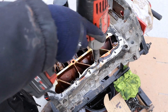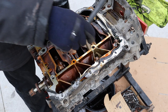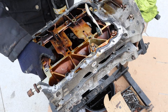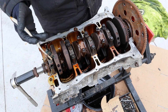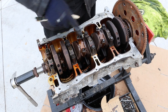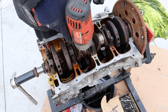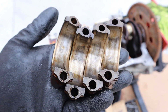Let's get these 12mm bolts out all the way around the perimeter. So here we've got the bottom end of this 2.0L engine — things are looking pretty simple. Because this is a low horsepower engine, we've only got two bolts on the main cap bearings, and there are five total main cap bearings. Here we've got the connecting rod bolts — these are a 10mm 12-point socket.